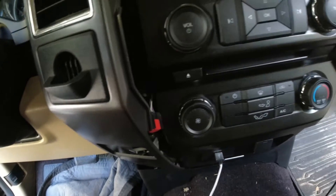Today I'm going to try to replace that switch. Also, we bought a small travel trailer and my truck didn't have a brake controller in it. Fortunately, the factory pre-wires them for brake controllers even though they don't install them. I was able to buy an aftermarket brake controller that's like OEM — it plugs directly into that plug. You pop a plastic panel off the dash, pull out the little coin tray, and the brake controller should pop right in place.